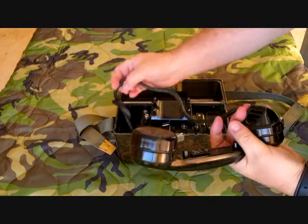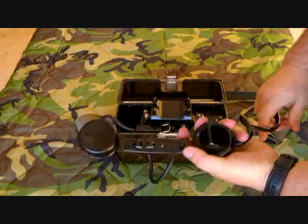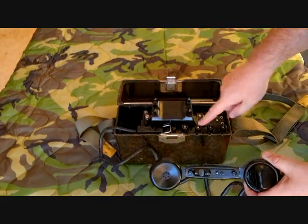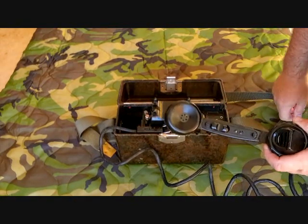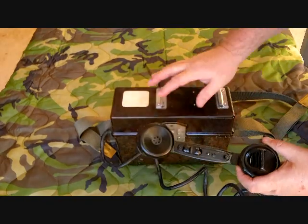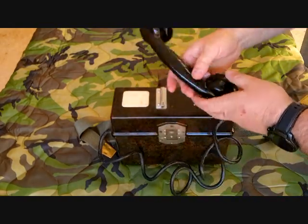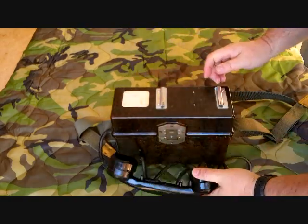The handset's very similar. The Poles did put a lot heavier-duty cord on it compared to the Soviet one. It's got the same standoffs. The case has got cutouts on it for the handset and binding posts, and it's got a third cutout right here for if you put the earpiece on it. When I get it out and hook the other phone up to it, we'll demonstrate that — but it's actually designed to be operated like this, with the handset rested over the top, and the standoffs kept the weight of the handset from pushing the top and running the batteries down.